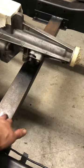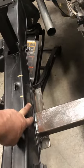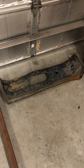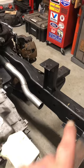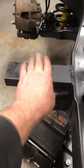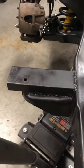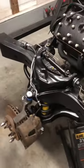I'm going to paint this here shortly. I just got it welded in and made it removable — this transmission crossmember here, made from angle iron. These are the original holes for the Durango crossmember. I've got the cab mounts here. The Dakota and Durango mounts are the same. I put this piece of 1x3 on, drilled holes where my mounts are underneath so they line up. I also replaced all the upper and lower control arms.